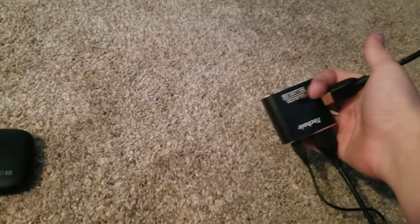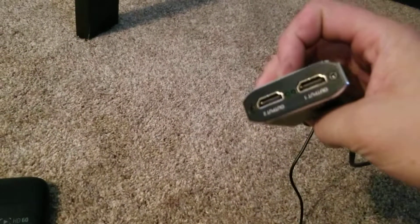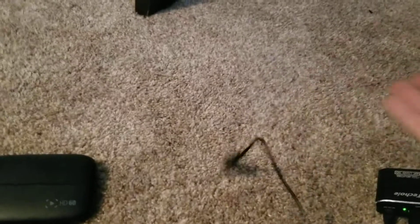Okay, I plugged it in. It really doesn't matter which way you plug it in. You plug the TV and the Elgato to the output side. When you plug in the PS3 side, it'll light up. You do need to enable the bypass for it, so make sure you have this plugged in or you'll get a warning saying your HDCP bypass didn't work.